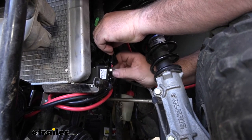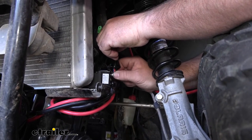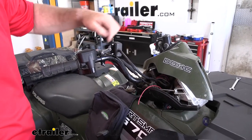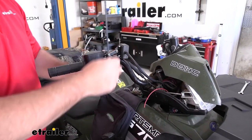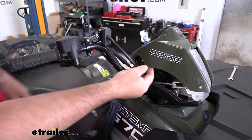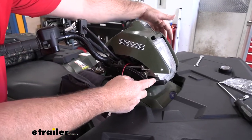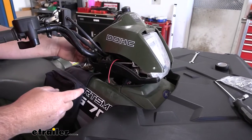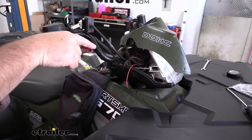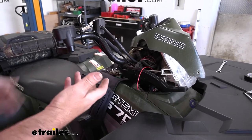This is going to be my longer positive cable — it's going to go to my battery. This is how I mounted my switch. Again, it's going to come with the bracket — just determine where you want to put it and tighten everything down. The cable is coming off it. I took these two panels apart — it's got three screws: one in the front, two here, and one here. And this will pop off and you pretty much have a straight line straight down through there right over to where the solenoid and battery are.